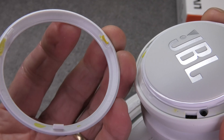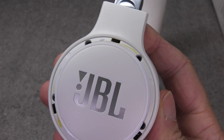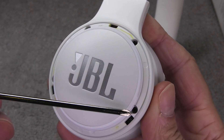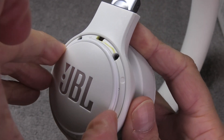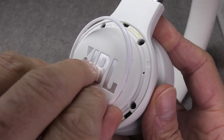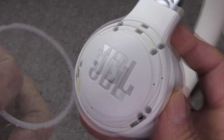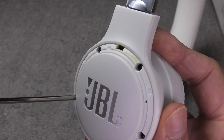Once the ring is loose you can see the three small clips that held it in position. Now we can see four more small Phillips screws in those tiny holes. But before removing those, detach the small white ring — it's really easy to remove, there's just a little bit of glue holding it in position. Then you can remove those four small Phillips screws.